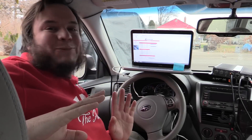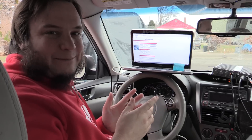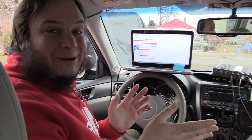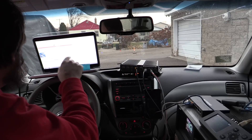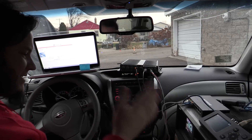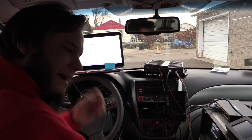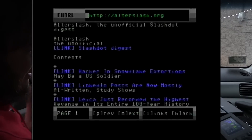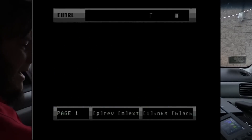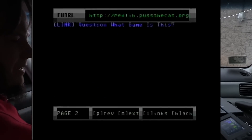That was a ton of fun in the chat room. I should probably wrap this up and stop idling the car though. Part of the reason for this video was to use up the five megabytes of data on the Inmarsat SIM, but I've only used 0.7 megabytes all day — that Commodore is just too efficient. This modem is really frustrating: if I turn it off and back on I have to re-enable the PDP contexts, basically allowing this IP address to access the modem, and you have to do this every time — it's a real pain. Now we can't get back to the BBS somehow. We can get to some websites through the retro campus browser — we can look at the weather website, Slashdot via the alt.slashdot.org interface, and Reddit via redlib.pussthecat.org in text-only mode. They do work, although they're a little kludgy.